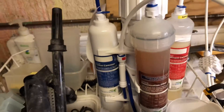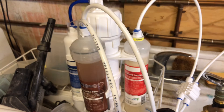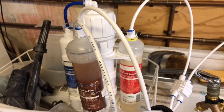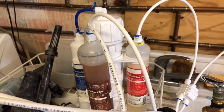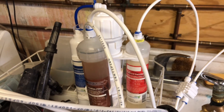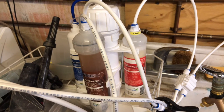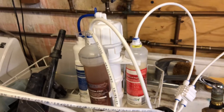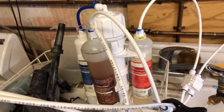I went on their website to find out when it's time to change the cartridges. You have to think about total water volume, not just clean water produced. Since it creates one part clean water to three parts wastewater, I created about 50 gallons and multiply that by three — that's the total volume that went through the RO unit. They recommend 1,500 gallons through the unit before you need to change the carbon and sediment cartridges.